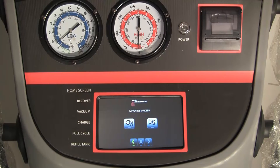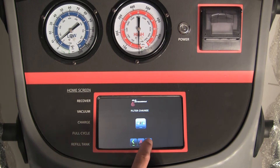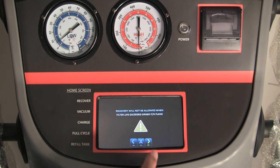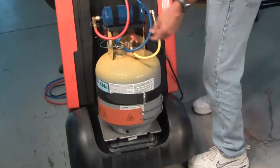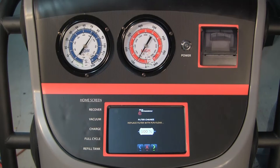Press the small settings icon on the bottom of the screen, then press the maintenance icon on the right side of the display. Press the filter change icon and then press the green arrow. The machine will display the filter part number FLO X5. Press the green arrow — the machine will prompt you to close the red tank liquid valve on the top of the recycle tank. Close the red liquid tank valve, unstrap the blue filter, and stand it upright. Once the refrigerant is 100% recovered from the filter, replace the filter with new part number FLO X5.